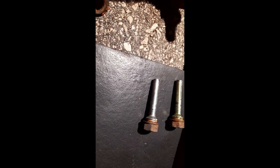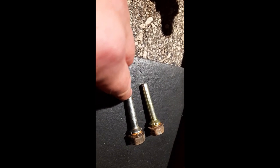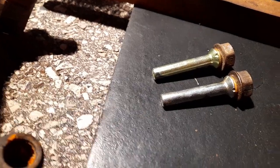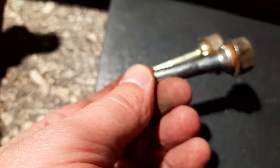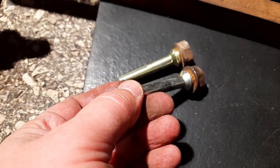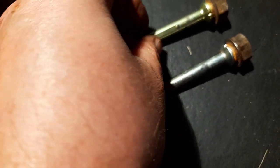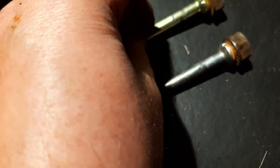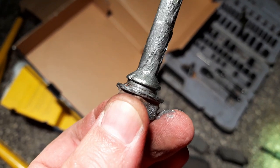Both sliders look okay — I cleaned them up. They're the same except the other one had this rubber bushing on it. They look good — no scars or peeling on either. One on top has a rubber end piece and this one is a little bit different without the rubber, but they both look good. Grease them up and make sure right at the bottom you seal it so water won't get in.